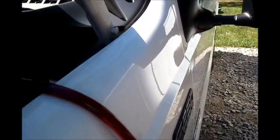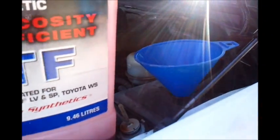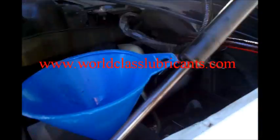and just a note: when you pull the return line off of the power steering, make sure you zip tie it up higher than the reservoir, otherwise your fluid will leak out. And that's about it. It took, I'd say, about 2 or 3 quarts. So just plan on using a few quarts to flush out your system. And that's it. It's that simple. Thanks for watching.